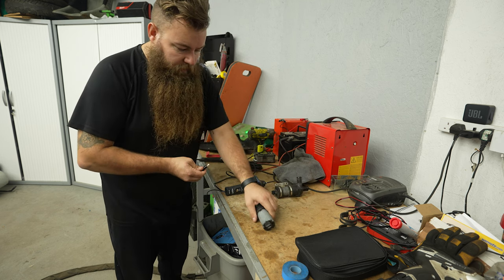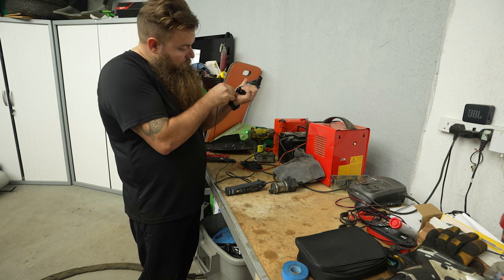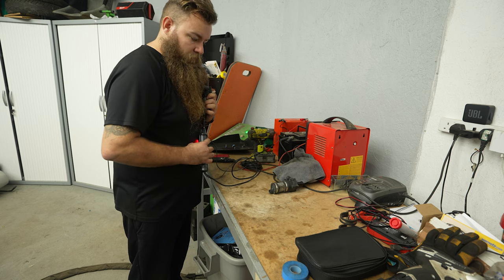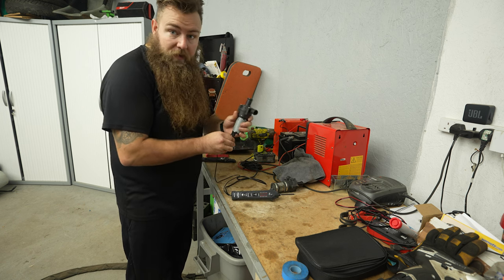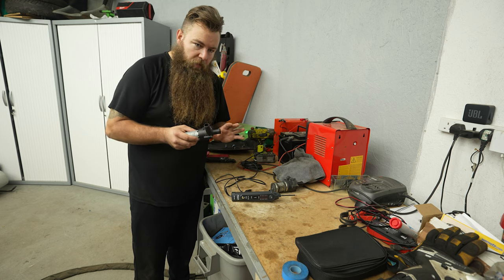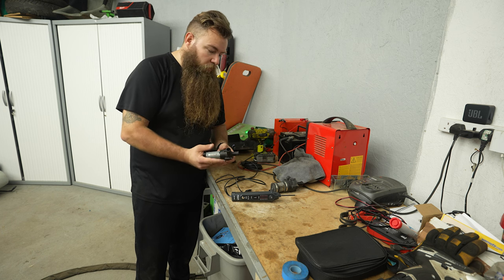If we take this brand new one I had on the shelf, connect up the negative — the ground — and put the probe on, you can hear it running. That's how it should run — it runs almost silently. If you're in a dead quiet place, you park up, turn the car off, you might just hear a faint hum if you put your ear to the grill. Just reach in, pop your hand against it or against the pipe and you'll feel the flow of water.